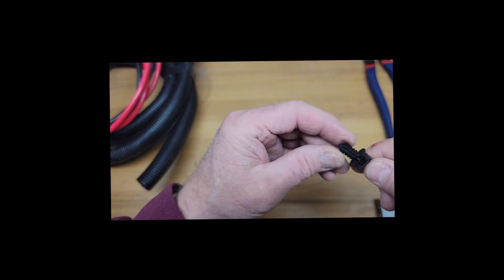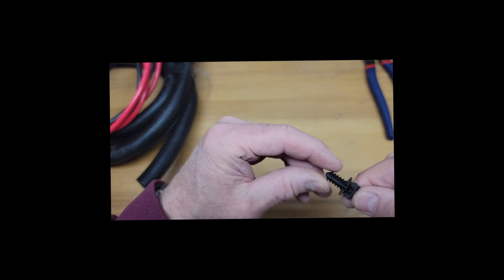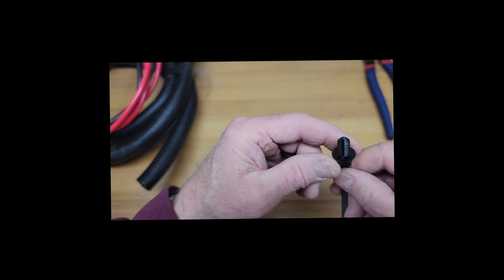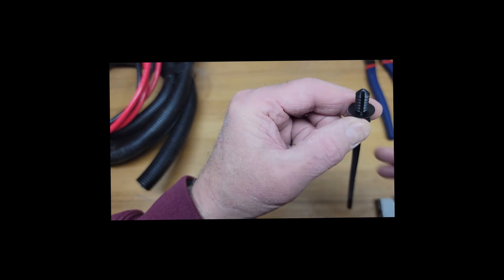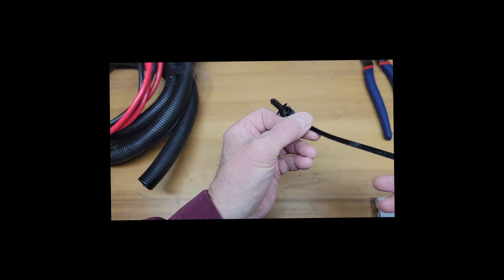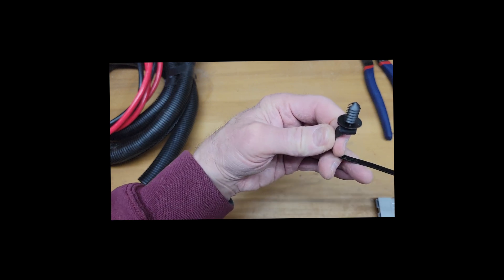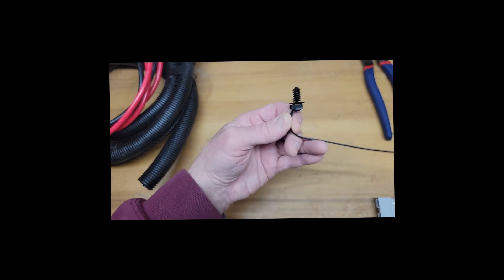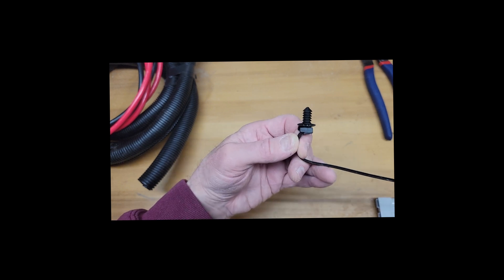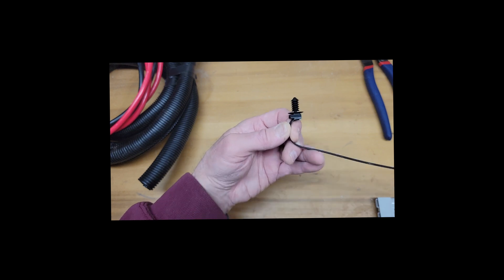I had to drill a hole along a couple of places under the truck in a cross member that's a lighter gauge steel than the frame steel. This is the largest push-mount zip tie in the package I bought. You drill a quarter inch hole, put the Christmas tree in, then the cable tie comes around, goes through and locks, and then you can cut it off like a regular wire tie. This came in invaluable going up along the frame where I couldn't tie off along an existing harness, so I had to find a place to run it. This made things much easier because I could mount the wire loom where I wanted it to be.